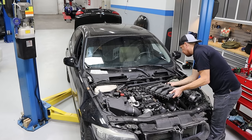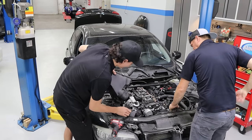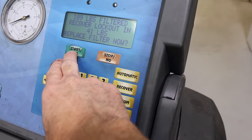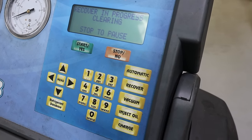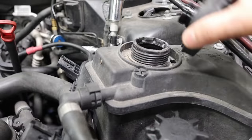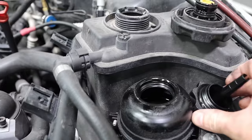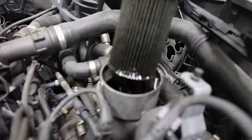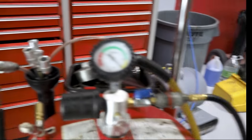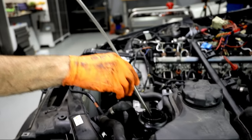This car has been sitting around the shop for a while and has been picked through. The intake manifold was loose so I went ahead and took it out of the way. I went ahead and evacuated the air conditioning system — we want to make sure we're not just opening it up to the atmosphere. This machine takes all the Freon out of the system and safely stores it so we can put it back later. The gauges show it's pulled the system down to zero. All the fluids are going to have to be drained. I removed the coolant cap and I'm using this machine to suck the fluid right out of the reservoir to limit the mess when I remove the hoses.